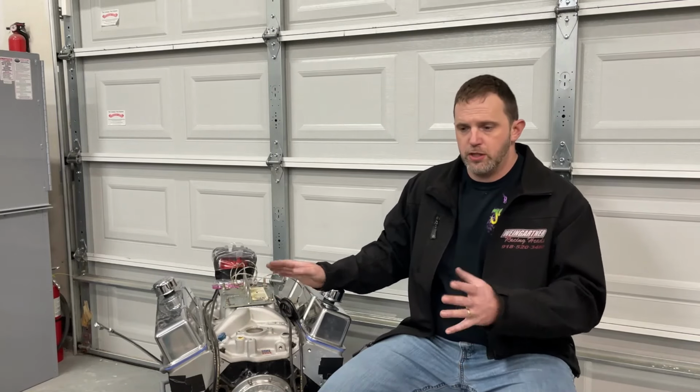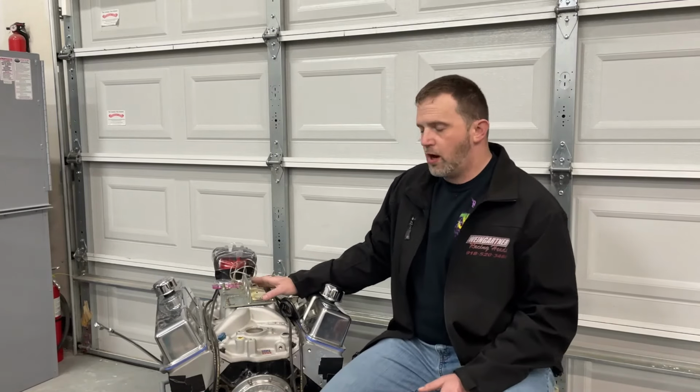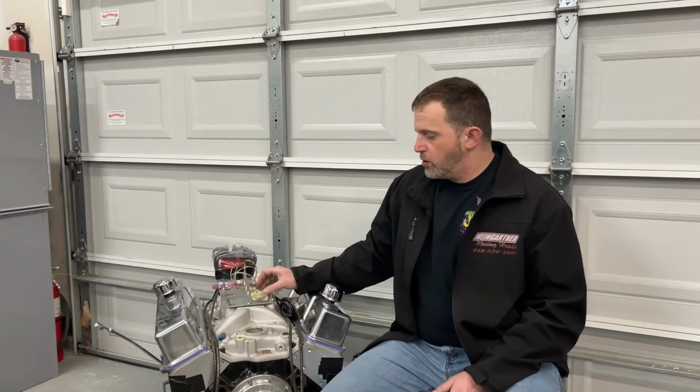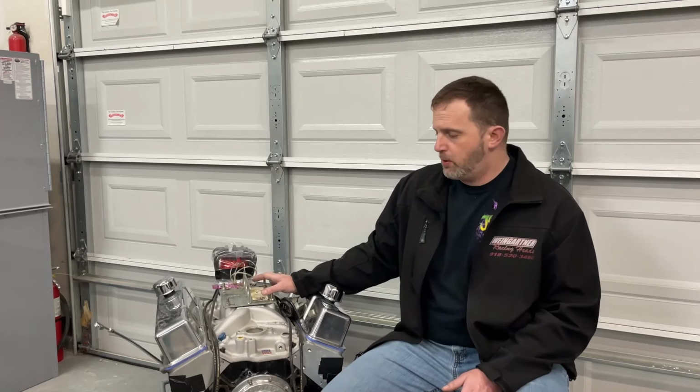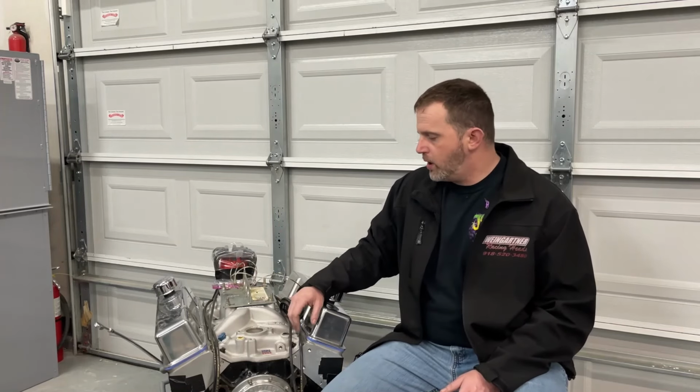So the next thing we tested, and I'm going to show you what these spacers are in the end, was we took off, and this is super quick, we took off the 1-inch and replaced it with an HVH 4-hole taper spacer that a customer was nice enough to let me borrow. And then put the carburetor back on, tightened everything back up and made a pull. Here's that pull.